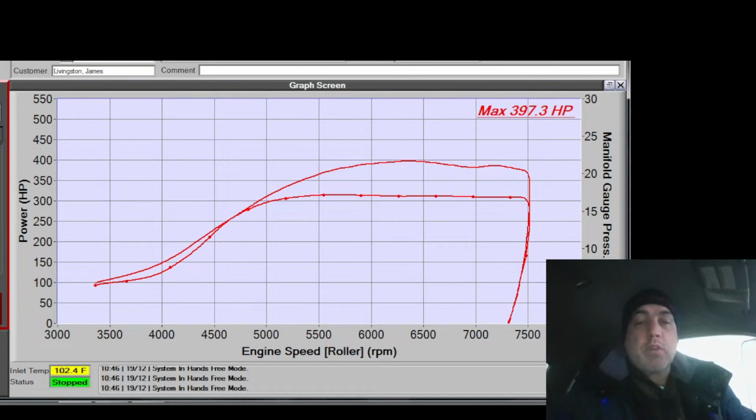This thing's this old claptrap. But during the pull, nothing. Everything's good. Definitely need to add some to idle airflow target because it just dips so fast and doesn't pick up very quick. So I'm gonna look at my decel adder. Decel.